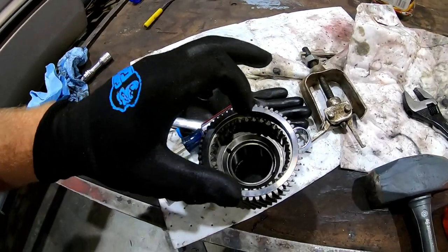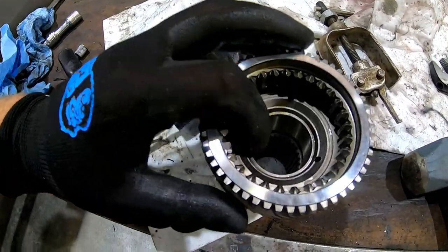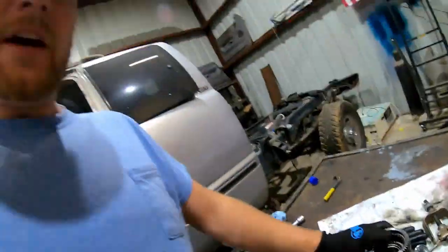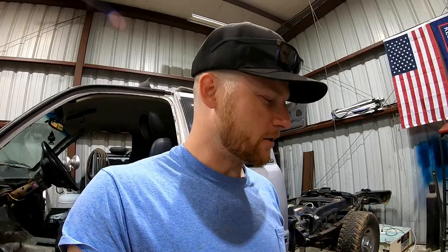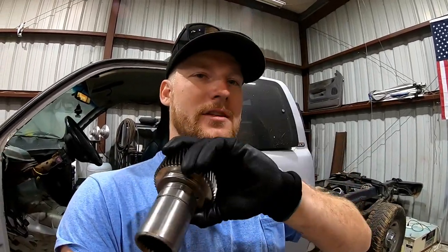Okay, disclaimer for anybody that has done this before and ordered one of these bearings: they come with two different sizes internally for bearing sizes, and this one right here is set up for the smaller bearing, but that piece in there is a sleeve. I did not know that until after I already put the transfer case back together, so you guys will see me go above and beyond and get a different part. Wow, this one could have worked, just letting you guys know. So I still have a good part that will work, I just have to get the sleeve out. Anyway, continue with the video, subscribe, like, all that.